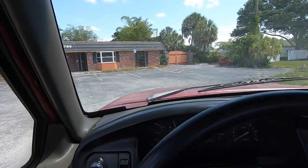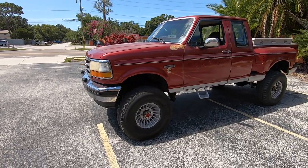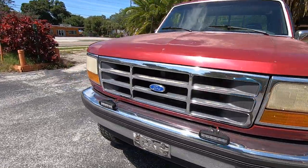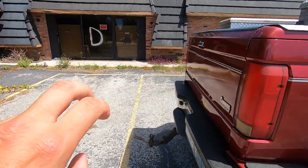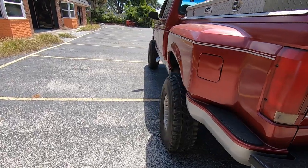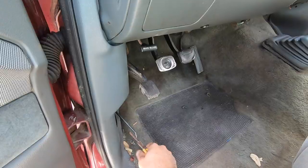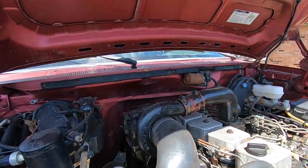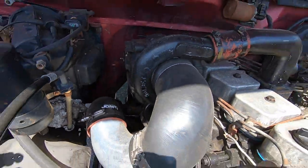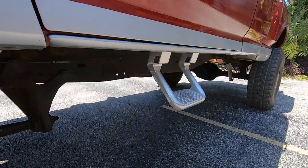This is super hard with one hand but we're going to make it work. Alright, here we go. So let's have a look at this awesome truck. This is a 1995 Ford F-150, it's a flare side — as you can see. Originally this was a police interceptor version; it's got the little badge here and it's also on the title. From the outside it's a pretty cool looking truck — it's jacked up and everything — but the real magic is under the hood. What we have here is a 12-valve that's p-pumped and it's twin turbo. There's a turbo right there and one down there. It's also a manual. Whoever did this conversion also did a front axle swap, so it's a straight axle.